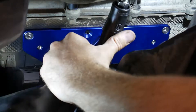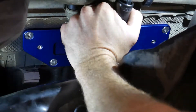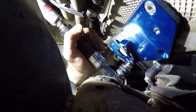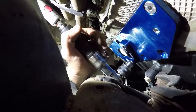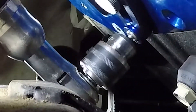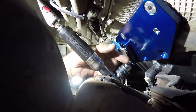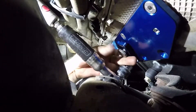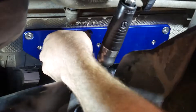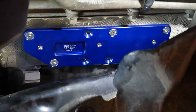Once you have all of this assembled, you can go ahead and start drilling. I did not have to drill very far before the stud started to screw into the head. You can see the drill bit goes into the head rapidly — that is the stud screwing in. My drill bit was not long enough to keep drilling in the center of that bolt, so I had to take the assembly apart and extend the drill bit out just a little bit to continue drilling.